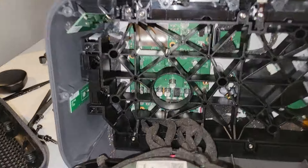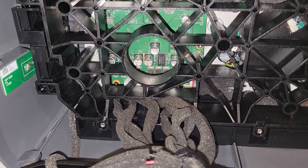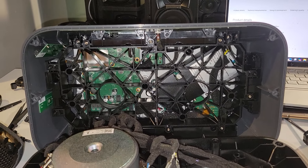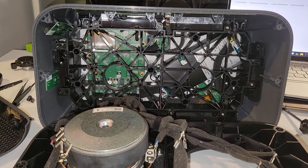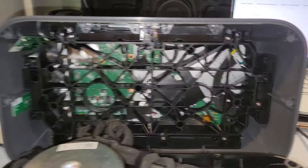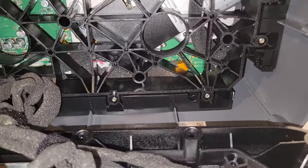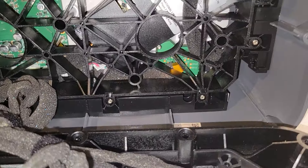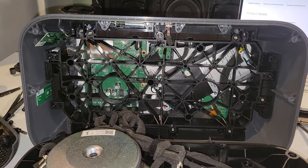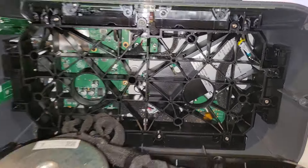Anyways, that's the speaker. So we're looking at 120 watts total. Actually, we could make this a battery-powered speaker if we really want to. It's 16.5 volts — that would be four 18650s or four 21700s for a prolonged period of battery life. And then you've got to get rid of that power supply and replace it with a charger brick or socket. It actually is doable — it looks very viable. So if you have a Google Home and you want to take this on the go, an 18650 pack is going to do the job. You've got to replace that power supply though.